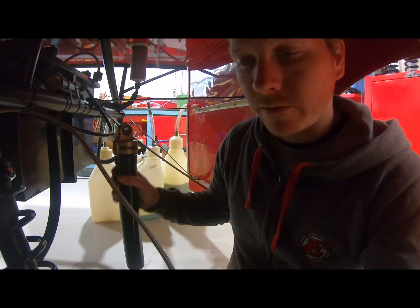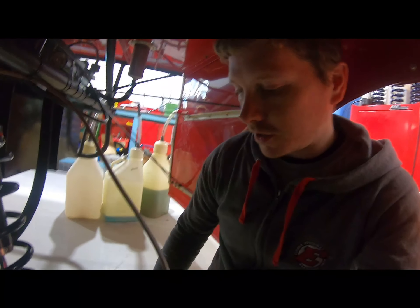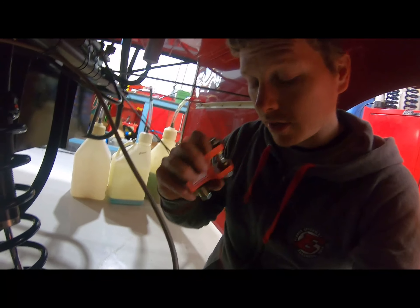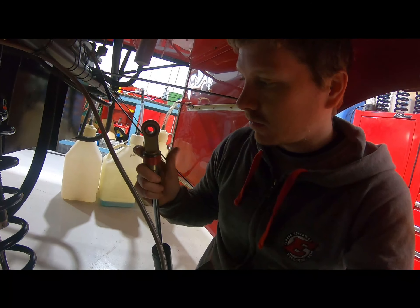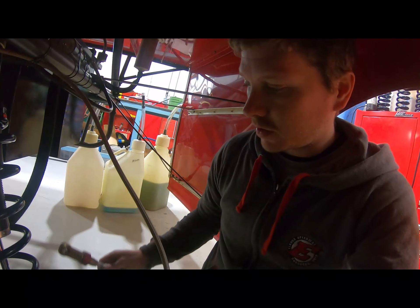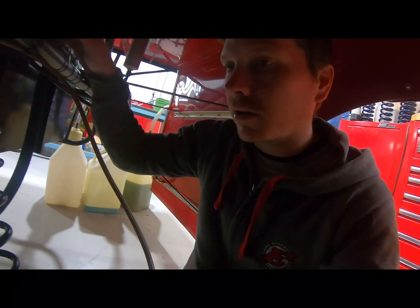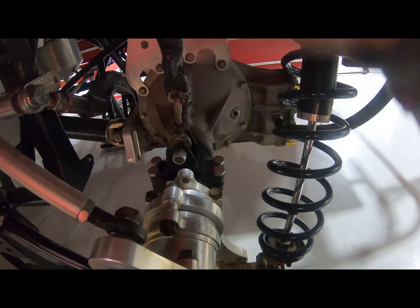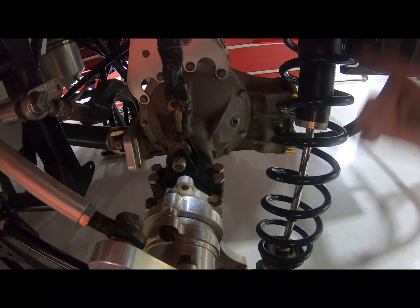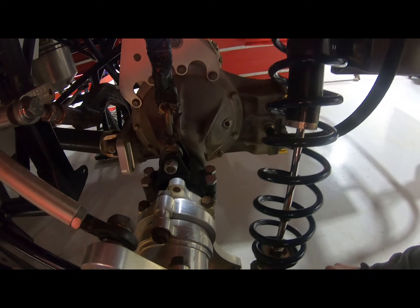I've got my left rear front shock — it's off the car right now because I've been servicing the car. If you're not getting enough extension even with the drop bracket, you've got to make sure that you've got shock extension — 1 inch or 2 inch. This is a 1 inch shock extension. It makes the overall shock body center-to-center a little bit longer. So take the chain off and see how far your rear end can drop out before it catches on the shocks. If it's not enough to get you that 4 to 4 and a half inches of drop, then you need to either get a drop bracket or get a shock guy to put a shock extension on your car.